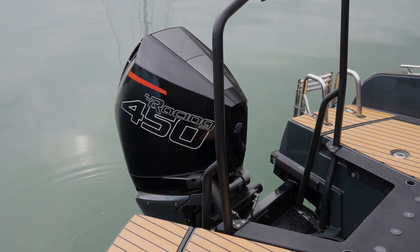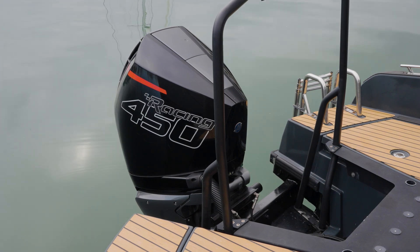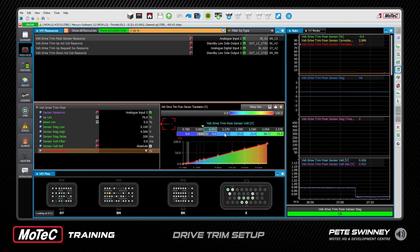Once it's right down, hold down for five seconds. We've got a correction of 2.8 volts there and now our trim position reads zero. Our calibration is built in, same as Mercury's — this is the only part you need to do at the ECU end.